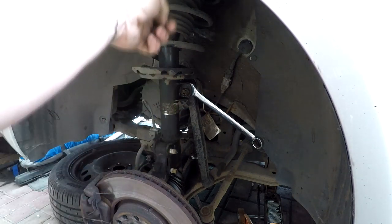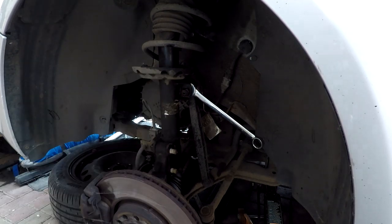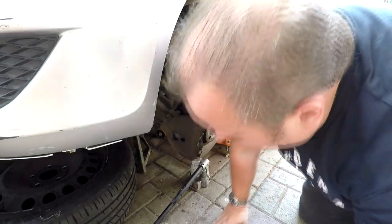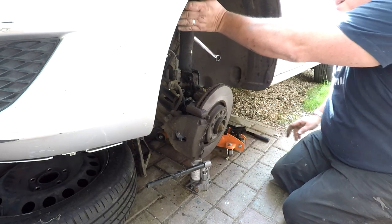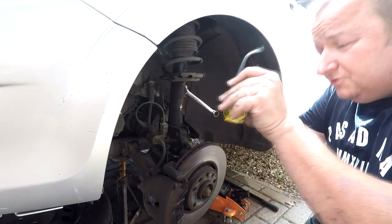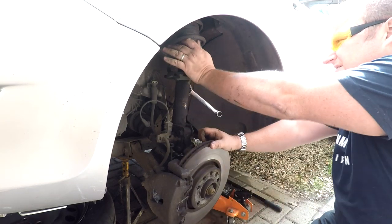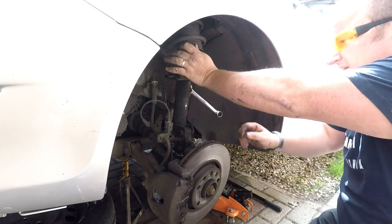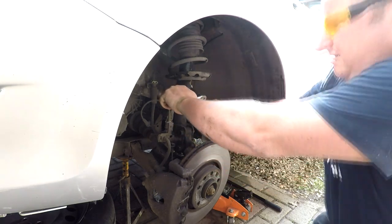Because our shock absorber is broken, I don't want to take that fully off yet until I get a jack supporting the actual hub underneath, because that looks like it's the only thing stopping the spring from forcing it away. I'll support that first and then undo that nut fully. I've just got this little bottle jack underneath the hub and I'm just taking it up a bit to hopefully take the tension off. That spring's really on the wonky and I'm not happy with it, so I'm putting some safety glasses on as well. It would be handy to have two people here.